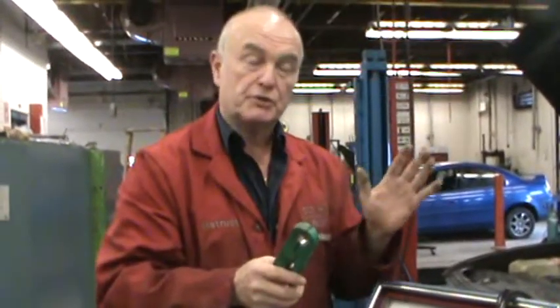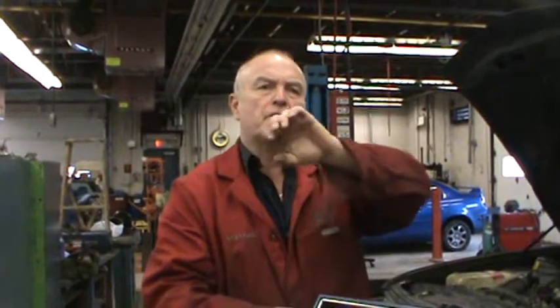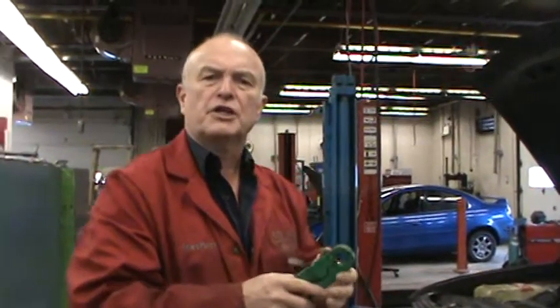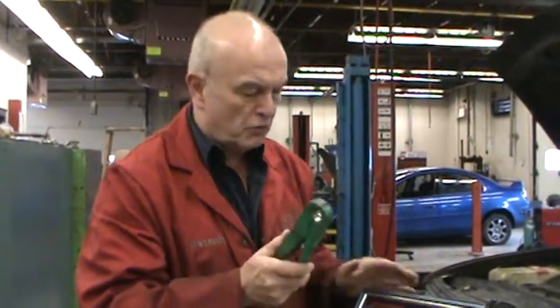When we're checking batteries, we put it over one of these cables, but when we're checking charging systems, we have to connect it around the negative battery cable with the arrow pointing away from the battery. The alternator pulls current from the negative to the alternator and back to the positive. So if we were to check the positive cable, we would have the arrow to the battery. We're going to have the arrow away from the battery, so we'll hook that up right now.